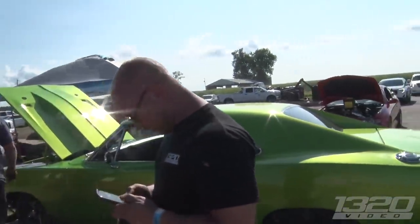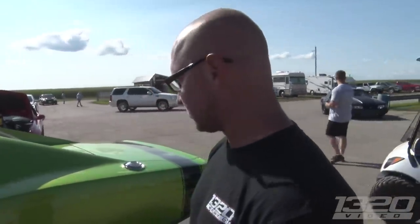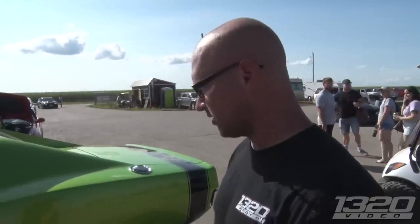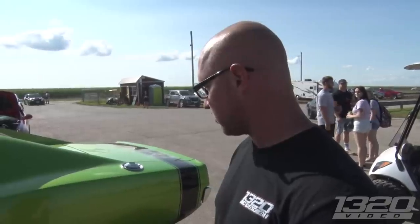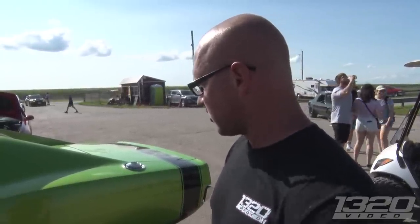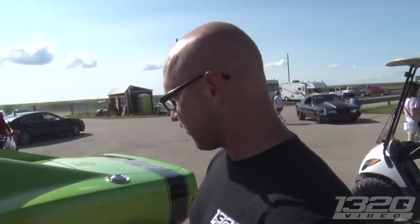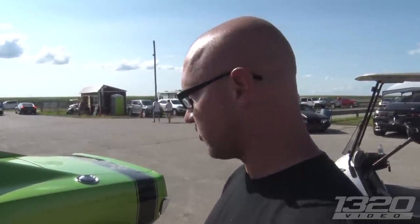The slicks didn't do what they hoped. The plan now is to turn it down for the first hundred feet or so to try to get it to bite. They're going back to radials because there are a few tunes dialed in for those with known shock settings. Had to turn in the 5.91 slip since the 5.79 didn't print — probably won't be as far up the ladder as they'd like, but they'll give it everything they've got.